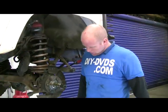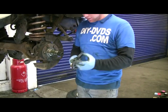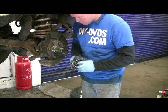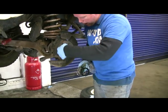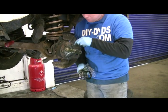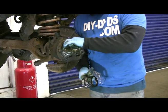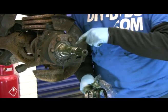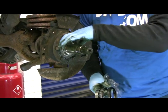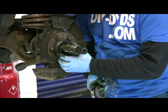I've cleaned a few bits and bobs up and I've got a couple of bits out of the package to show you. That's the seal that goes in the back of the hub — that would go on first and it seals on this ring. Just while I'm standing here showing you this, there's a collar on the back of the stub axle. On early Series Ones, Twos and Threes as far as I know, that collar is about five to eight quid and you can put a chisel in there, bang, and chase it off. You only need to do that if the oil seal runs on it and it's worn.